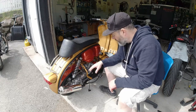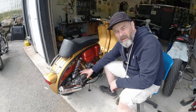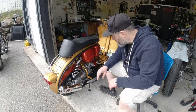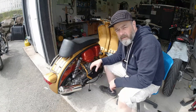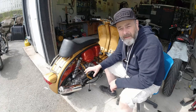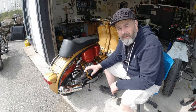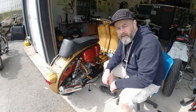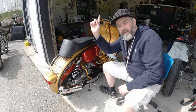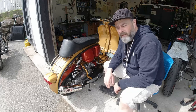We ended up with a new mag housing and sorted the clutch and all sorts of stuff. He's done a terrible job of the cables here so I'm going to sort that out as well. He can't select all gears - I understand why, he's put all the wires on the top and they're in quite a bit of tension. I'm going to loosen the whole lot and start from scratch on the cables while he's away. If you're interested in the engine video, it's about half an hour long - well worth grabbing a coffee for. I'll put a link in the description.